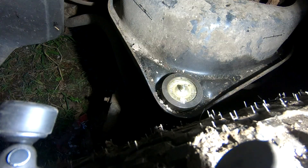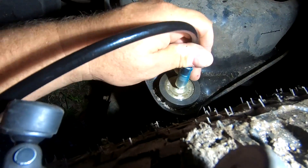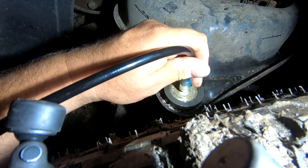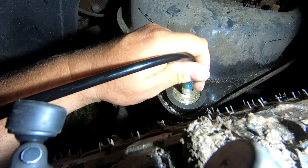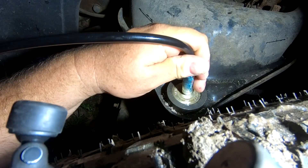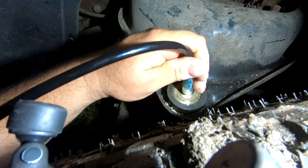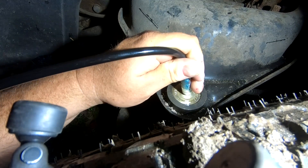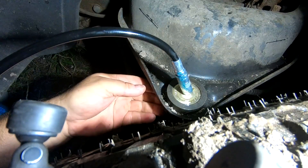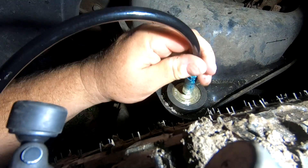I'm gonna cut the fan off now. All you gotta do is stick your grease fitting on top — and these are new ball joints so just kind of pump kind of hard. You just kind of look down to the side, which I'll try to show you on the bottom, and you wait for the bellows to bellow out.